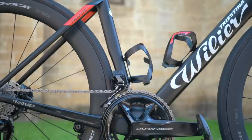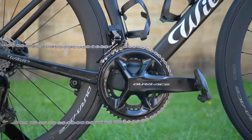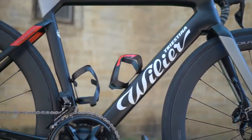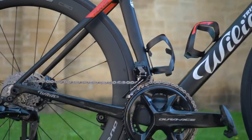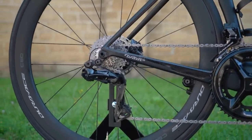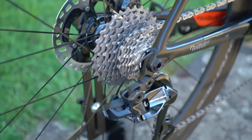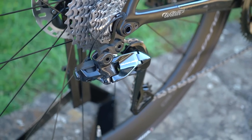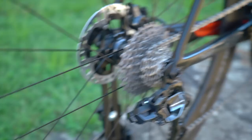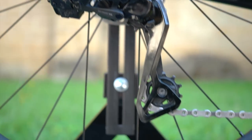And for now, the main purpose to go to 12 speed was not just a number, but the fact that we've seen that racing has developed also in different areas: more extreme climbing, faster sprinting. And one of the feedbacks we got from teams was that with the existing offering of 11 speed, it was impossible, without making many changes during a stage race, for example, to have one drivetrain that suits all. So the range and compatibility, without having to change too many different front gears or different rear derailleurs, even with a longer cage, was no longer really practical.